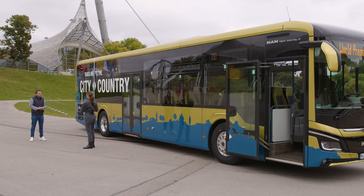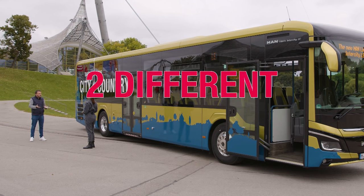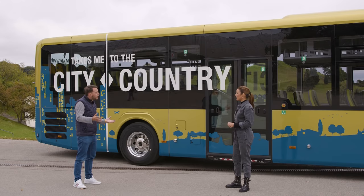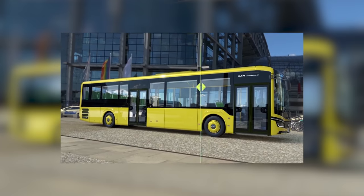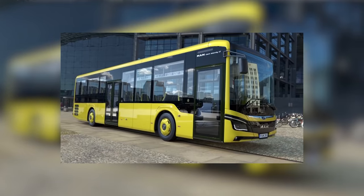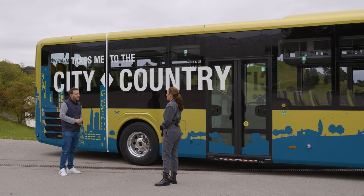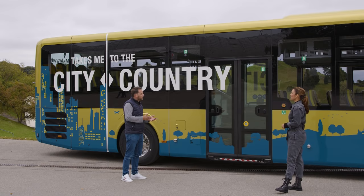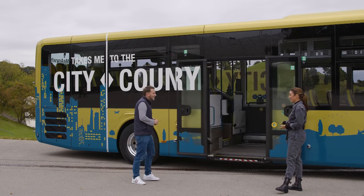Looking from the outside, what can you change here? You have two different tire sizes: the small one for more city-oriented application, or the bigger one for more intercity-oriented application. You have three different lengths: 12, 13, and 14 meters. You have different door types — inward swinging, outward swinging, or sideward sliding doors, small or wide. This model today has the typical intercity application with the double-leaf outward swinging door. Let's take a look inside.